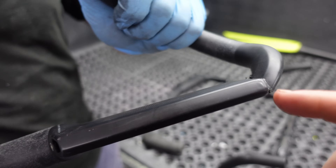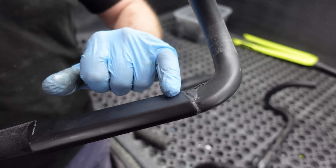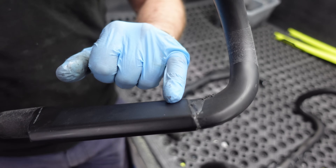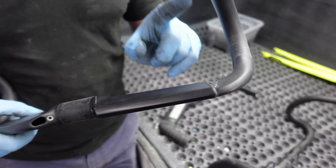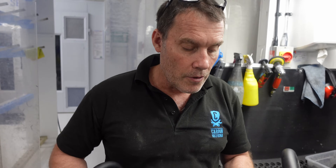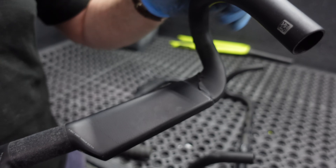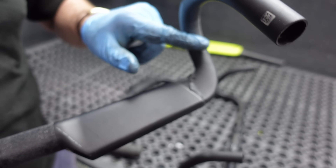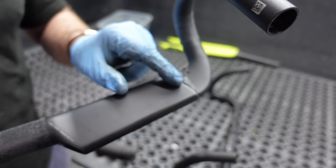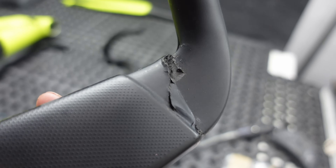Very thin — you can see where the wall changes. This is the danger of having wall thickness changes. Repairs must maintain the same wall thickness all the way around, because this is what happens: imagine this is a repair patch you put on your own bike — suddenly you've got a real issue where this section is quite strong, but as soon as you place it right next to a really thick section, it breaks right there. That consistency of wall thickness throughout is critical.